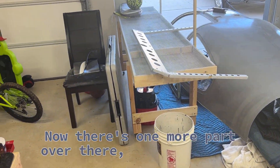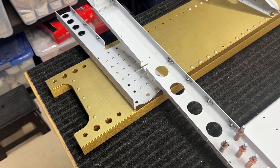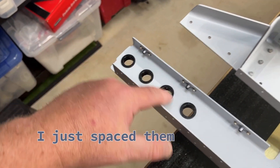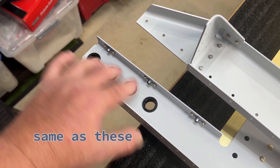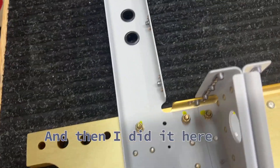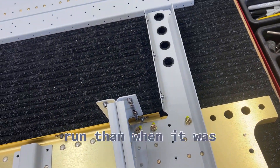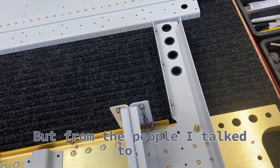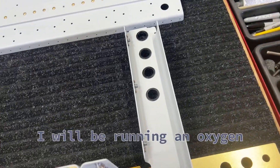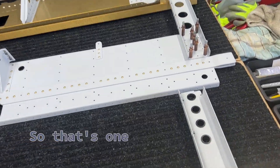There's one more part over there — nothing fancy. I went ahead and added two more holes here, spaced centered and evenly, same as the existing holes. I did it on the other side as well. There's just a lot more wiring to run than when it was originally made — I might even have to do more. From the people I talked to, four holes on each side seemed good. I'll be doing electronic ignition, running an oxygen system, and running a ton of wire for avionics.